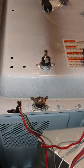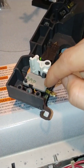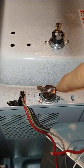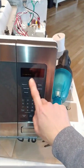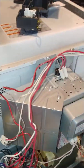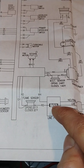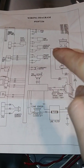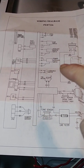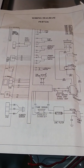If you blow yourself up or a fire happens, I am not liable. I'm going to replace this micro switch and this temperature thermostat and see if that fixes it. The symptoms were that it was finicky with the display, and when I plugged it in there was no power and nothing on the display. That makes sense since the live wire goes through the fuse — which showed continuity — and then through this burnt thermostat, so no electricity was reaching the control board. Hopefully replacing those parts will solve the problem — I'll write in the comments if it worked. Hopefully this helps you out.